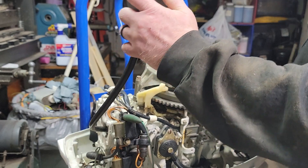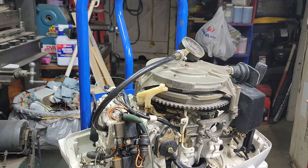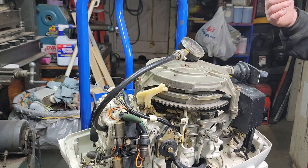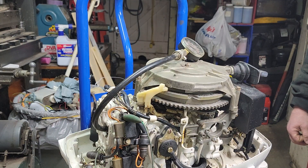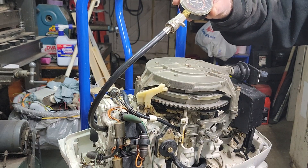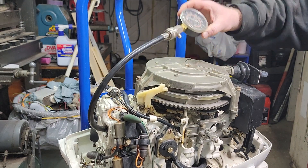There you have it. We got 145 throttle open and throttle closed with the recoil. We got 120 with the drill, throttle open and throttle closed. What you're really measuring when you test compression is how much pressure the rings hold before you get blow-by — and this motor's at 145.